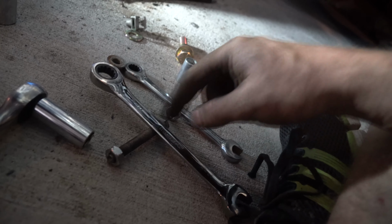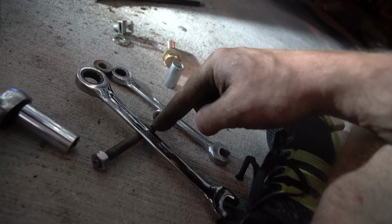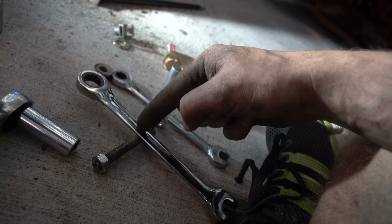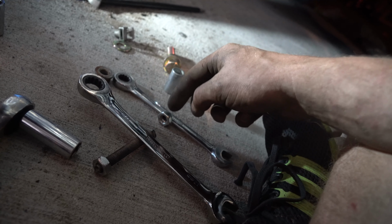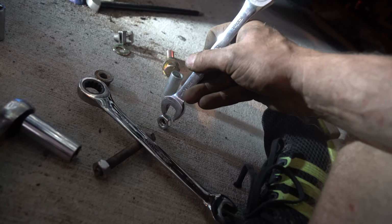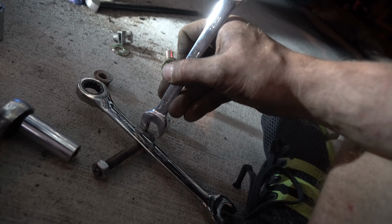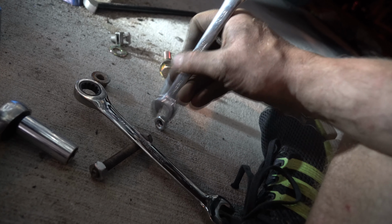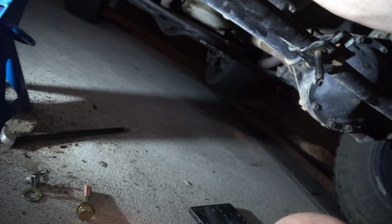So after you tighten this bolt, and it's over here and this one's over here, you're going to slowly crank this and it's going to pull the wall away. You don't have to do anything with this one, just basically leave it. And if you can, put a ratchet on this end. And then what you're gonna do is, as you separate the two nuts, it's gonna widen it to help you slide that sleeve in between there.